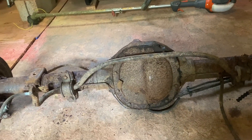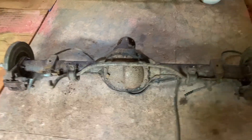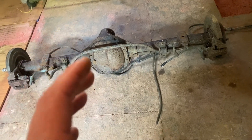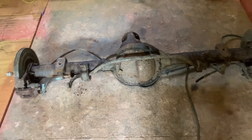I'll put a picture of how to decode one of the tags here. That's what the tag looks like — that'll help you decode it a little better. The reason I want the open diff over a limited slip: limited slip would have been great, but with an open differential the carrier is a little bit stronger because they don't have to cram a limited slip in it, so the carrier is a little bigger and stronger. It also makes it a lot easier to throw in an aftermarket locker one day. Right now I'm not sure — I might do a lunchbox locker, an Aussie locker, something like that. Has yet to be determined.